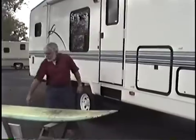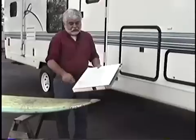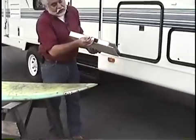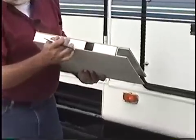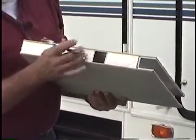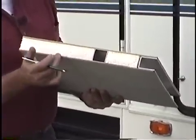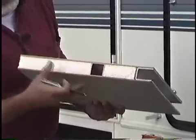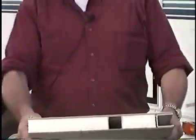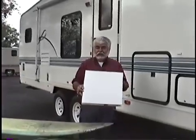Here's an example of the sidewall construction we use. We have fiberglass skin on the outside, mahogany plywood right here, then we bond that with hot urethane cement to the foam insulation — an inch and a half of it, the same kind used in our coffee cup. This has some of the aluminum frame sections in it, and on the inside is our inside sidewall paneling. This is a very lightweight, rigid structure that takes a lot of expensive tooling to make.